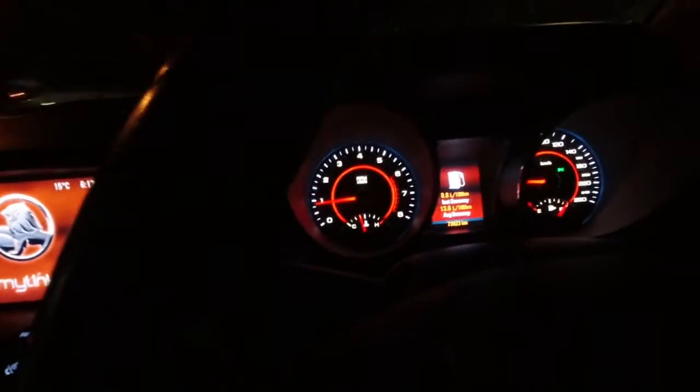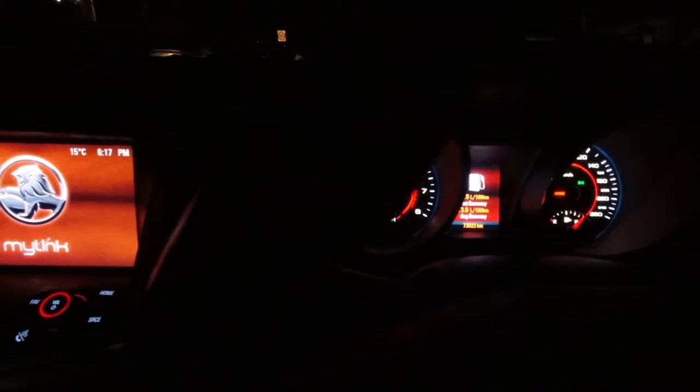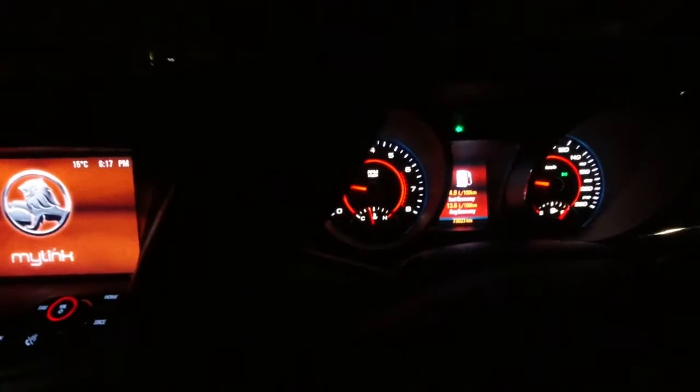We're going for a quick test drive on the road with parameters logging. What we're chasing is that when changing gears the revs seem to hang — it doesn't follow driver input well and has been a customer complaint. As I put my foot on the clutch and take my foot off the gas, the revs stay at around 2000 RPM for about half to three-quarters of a second before decaying down — as if there's an excessive flywheel effect. What we want is the engine to return to idle as fast as possible when the throttle is released.